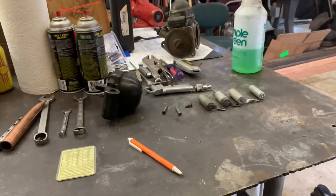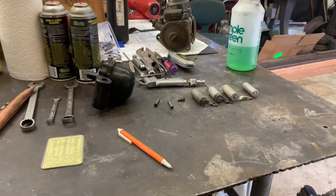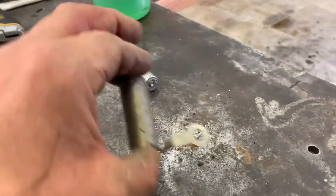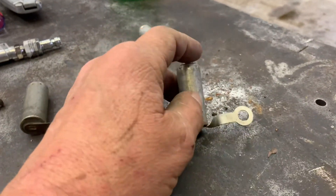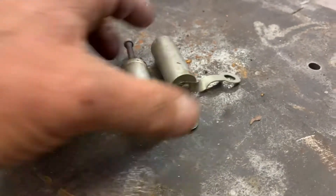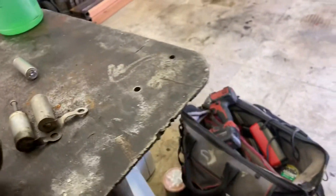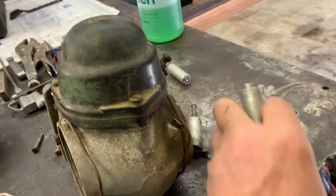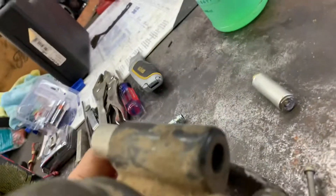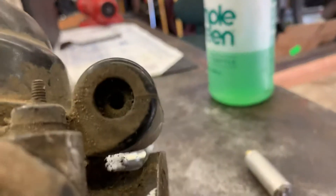Here's another video about what I did for a condenser for my '36 Ford pickup. Here are some different condensers — notice how the tab is longer on this one versus the other one. What's got to happen is this condenser fits in here, that's the long tab, and then it screws in — there's a screw that screws in there.